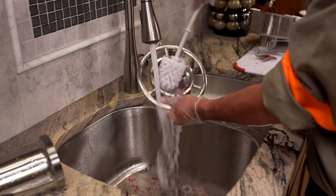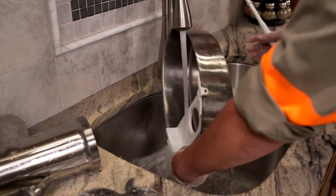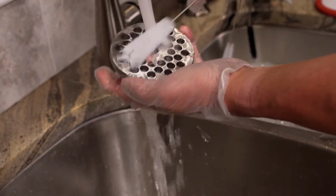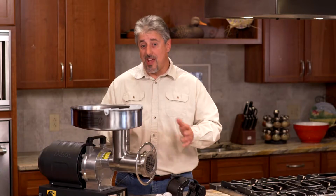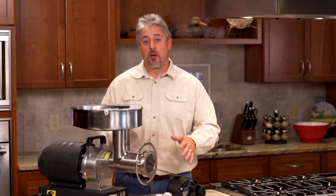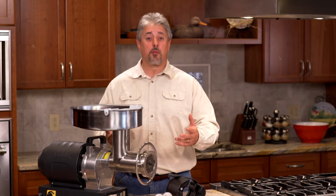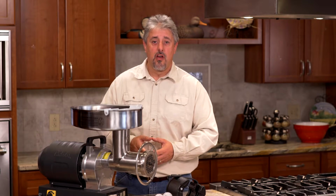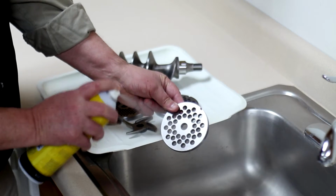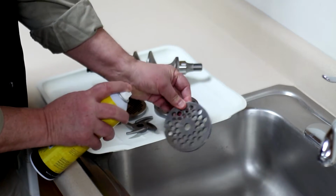Be sure to wash all parts thoroughly in hot, soapy water, taking particular care to remove all grease and oil from the surfaces. Rinse and dry everything thoroughly before reassembling. Always hand wash. Parts are not dishwasher safe. Proper maintenance of your Cabela's grinder is the best way to extend the life of your grinder and protect it from corrosion while it's in storage. Start by fully lubricating all parts that come in contact with meat by using a food-grade silicone spray available from Cabela's after each use.